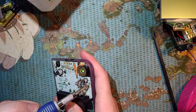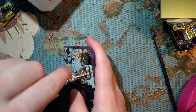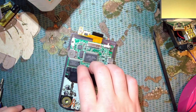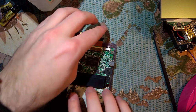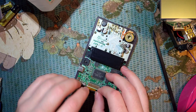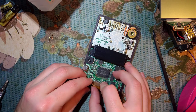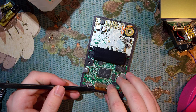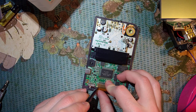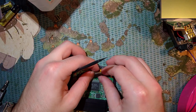I also took a few minutes to clean off the adhesive around the screen lens, which you'll want to do if you're replacing the lens. It'll just make for a cleaner install - nothing mission critical, but it helps. Once you've got the motherboard screwed down, you'll need to flip this over and insert the ribbon cable. Unlike the V1 kit, it is not super, super stiff.